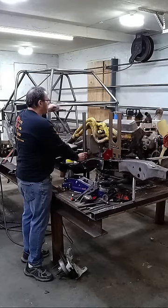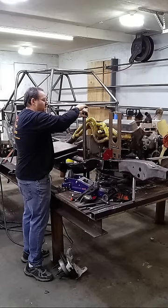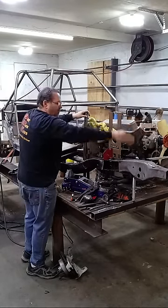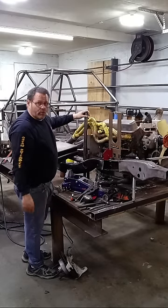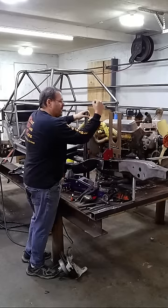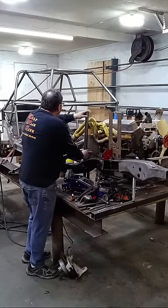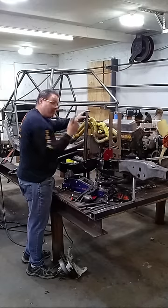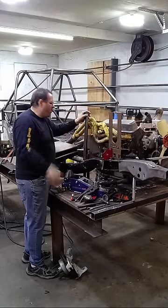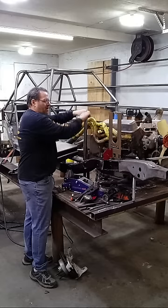All right, so this W right here is what's going to help give support for these towers because I am going to have a shock right here, okay? And I don't want just this one tube going all the way down through here. These zero-point shocks, they get a ton of pressure on them. And so I don't want to twist this tube and literally flex this entire structure in and out. Well, that W coming in from that corner right there will help to stop that. But if I do the bend, then that W is coming in on the back side of that arch. That's going to be funky. So I do think that it ends up being a three-way joint of the tubes there.